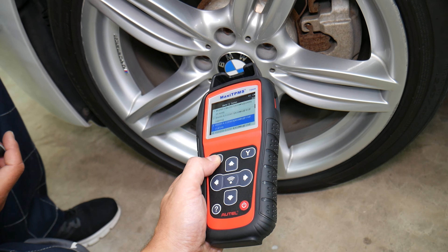This is a new blank sensor — you can buy new sensors at a really good price; we'll put the link in the description below. This is the old sensor in the wheel. Let's say we have a spare wheel, spare tires, or a winter tire set, and you want to program them. You go to the TPMS tool right here — we'll put the link to that tool in the description as well. It's a tool that can pay itself off in just one use. Select yes, BMW, yes, 5 series — our sensors are from 2014 to 2016 — yes, program sensor.